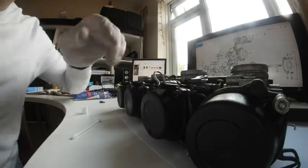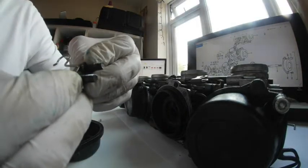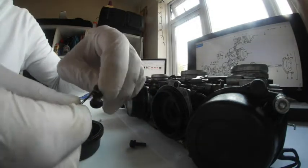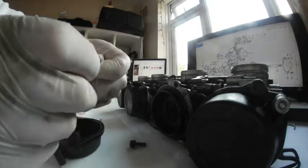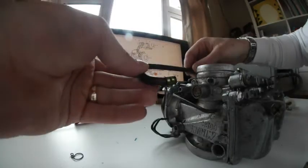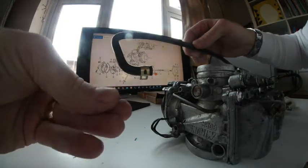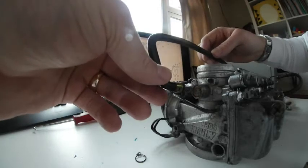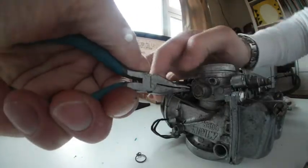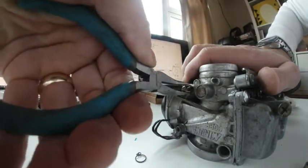With this screw, the difference is that it has this metal seat. The bolt is still the same length — the only difference is it doesn't have a collapse washer on itself. That's ready to go so there's no fuel coming from this end, only air. The only thing I replaced is the old clamp because it's obviously out of shape since I removed it. I just slide this clamp down.